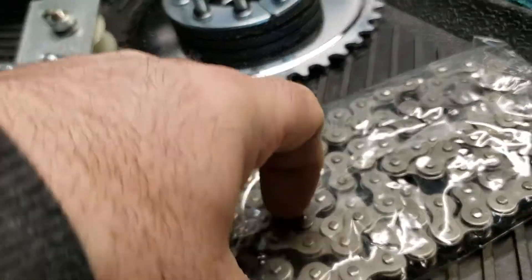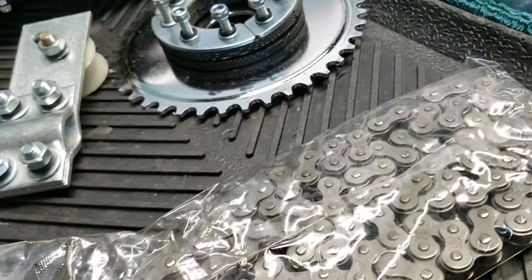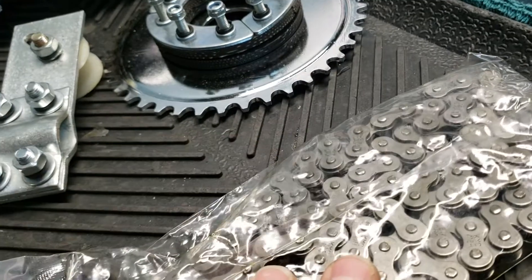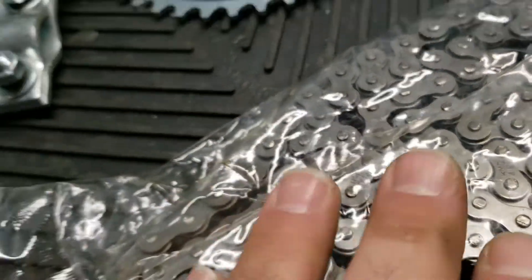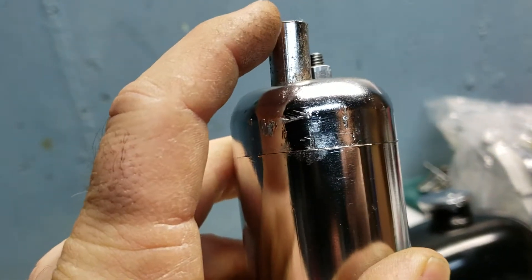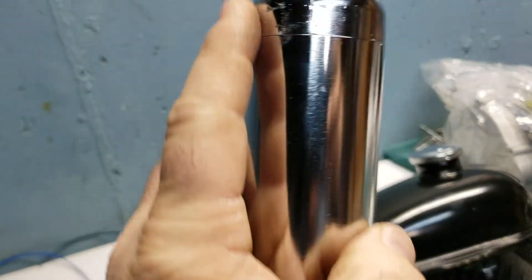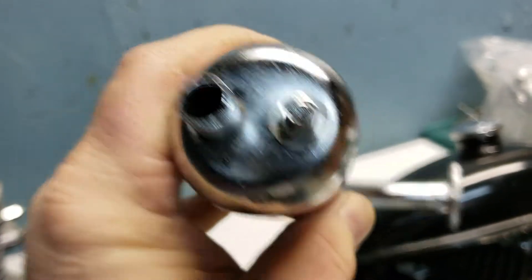The 415H chain is, in my opinion, the best chain you can get for a motorized bike — way better than the chains that come with other kits. These are really heavy-duty chains. The muffler — I do some modifications to it. This little tube goes all the way down; I cut this tube to about right here inside and then I drill this out because there's a lot of slag from the factory.